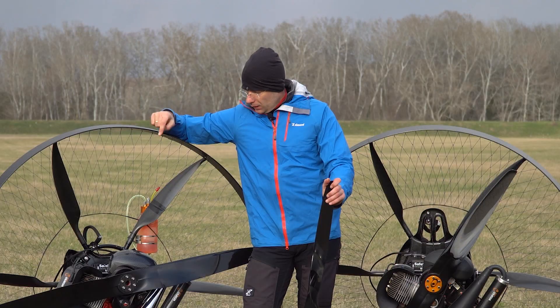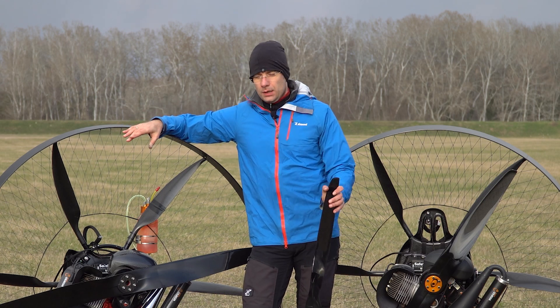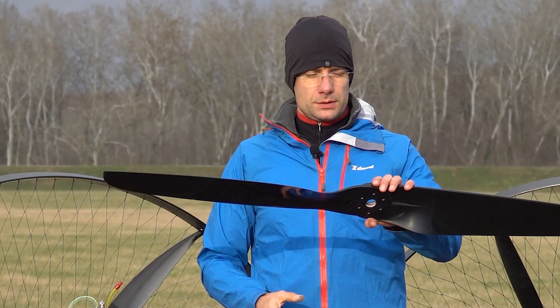I will simply measure how many minutes and seconds it takes for the engine to burn the whole bottle. I will open the valve, start the stopwatch, and stop it when the engine dies because of fuel starvation. On this particular engine, I have installed the 140 propeller. I'm super excited about that one. But to make it a fair comparison, we will also test the 130 today — this one has 132, so it's more equivalent.